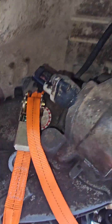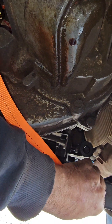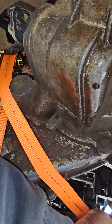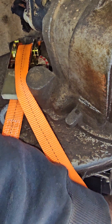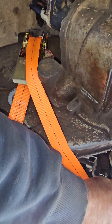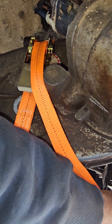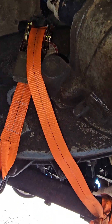So I obviously have a linkage problem — it's not the four wheel drive part itself. I drove it like this in two wheel drive and it stayed. It was late in the evening so I didn't make a video, but now I'll just have to crawl underneath here every time and manually change it from four high to four low. We'll see how that goes.